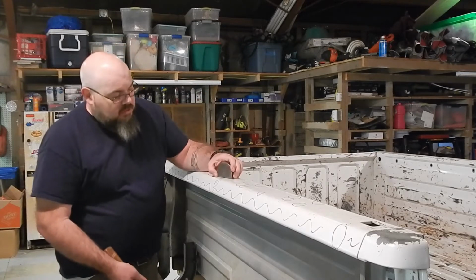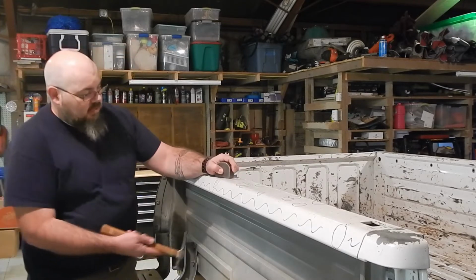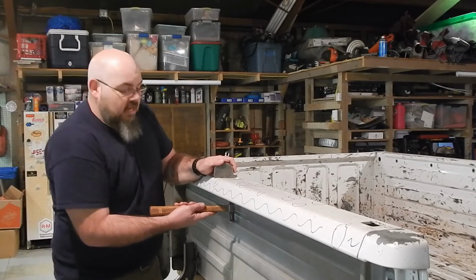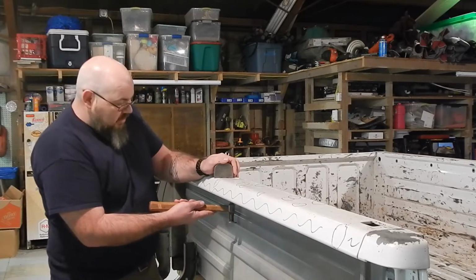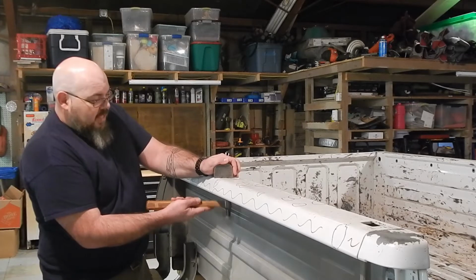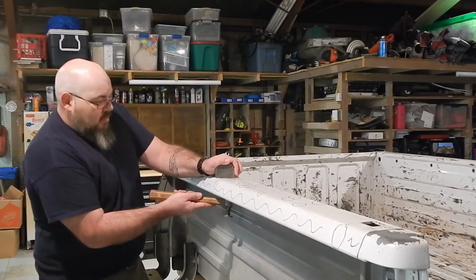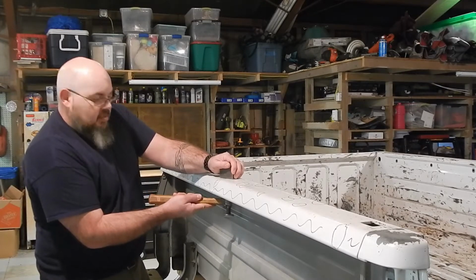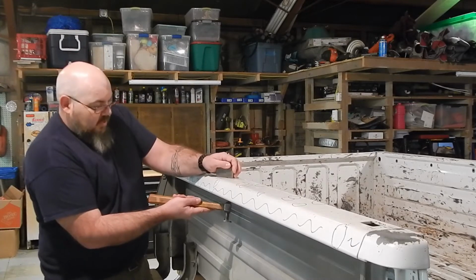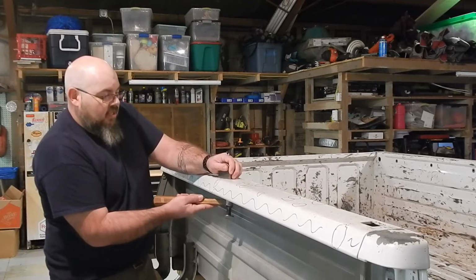So you're going to just kind of want to watch it, get your dent in the light so you can actually see, and you'll see your hammer. I may be coming out of screen, I'm not sure, guys, but you'll be able to see where you're hammering and see that metal rise up as you go. Hear that difference? That's because I'm right on the dolly now. When it's off to the side, it's got a much more hollow sound, and you can hear it solidly from that.